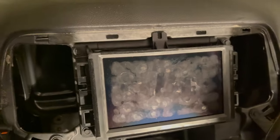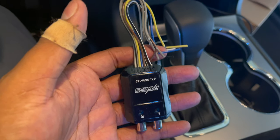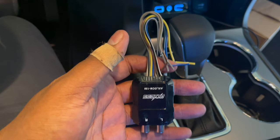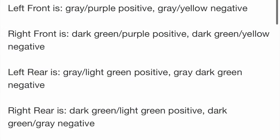To remove the radio it looks like a few hex bolt screws. Some of these tabs can be a bit tricky, but if you pull out the big connector you'll be fine — you squeeze it and pull out. Once you have your line output converter and you get behind the radio, you basically need to splice the wires together. I'm going to attach a wiring diagram — I suggest you pause the video, screenshot it, and then read the directions on your high-low converter because each one is different.